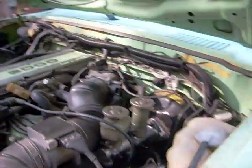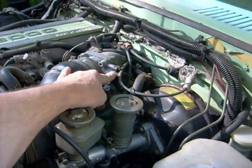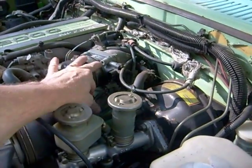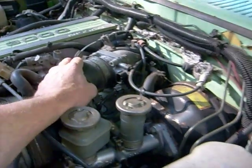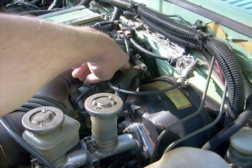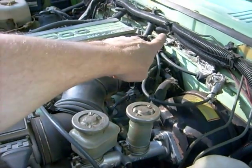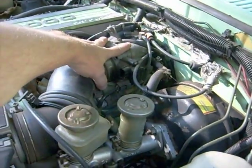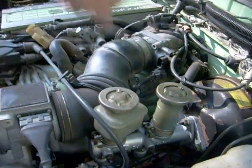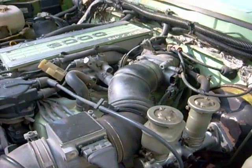I went ahead and got the TPS. It's OBD2 since it was a 95 Altima — 95 through 98 uses this TPS — so I adapted the harness, which was no big deal. The coolant elbows are epoxied into the aluminum throttle body, so I removed those with a press, flipped them 180 degrees so they would line up with the coolant hoses on the 300, then epoxied them back in place. That was a done deal.